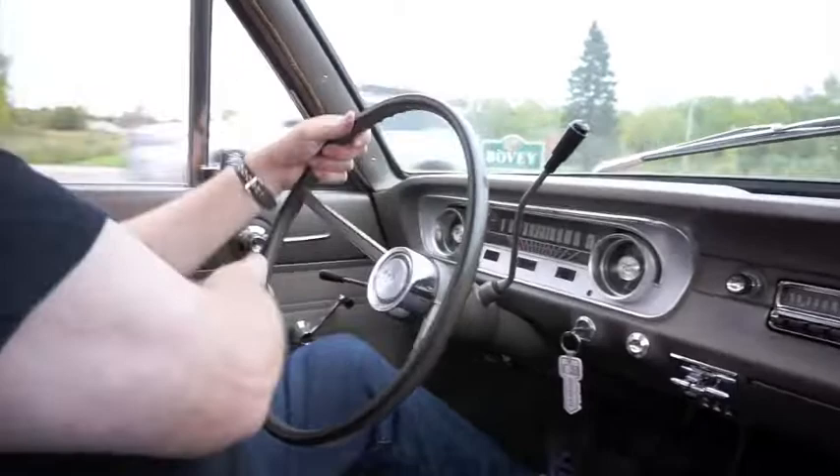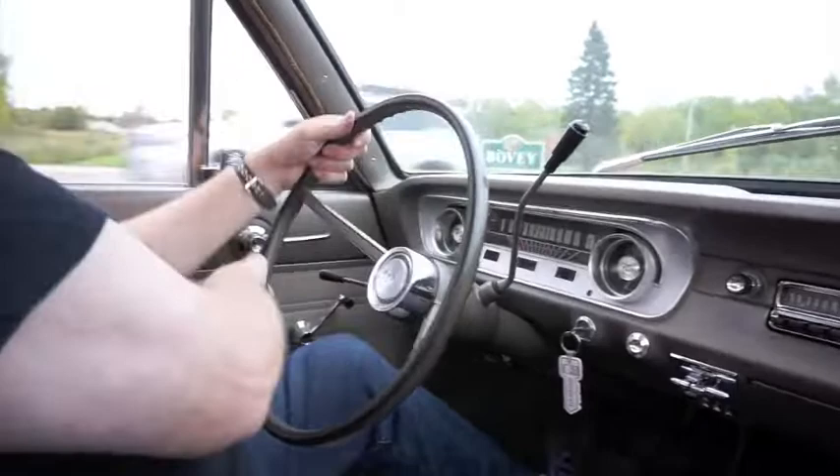Water pump is new. Fuel pump is new. Fan belt is obviously new too — it was one of those 'as long as we've got it apart and these parts are not that expensive, we may as well replace everything' situations. Parts for these little six-cylinders are real cheap. And the three-speed is not synchro-mesh in first gear, so if you've got to slow down that much you've got to stop if you want first gear. You can kind of squeak it in, but you're really not supposed to. So anyway, that's the tour.